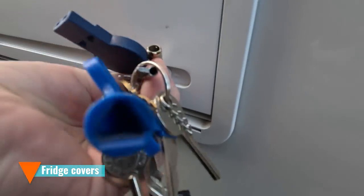When on site with water in the tank, make sure your tank heaters are switched on to prevent freezing — very important if you have them. Also make sure you're using propane gas rather than butane. Propane comes in red or orange cylinders; butane comes in blue cylinders. Butane doesn't perform as well at lower temperatures and may not work in the cold, which is the last thing you need.